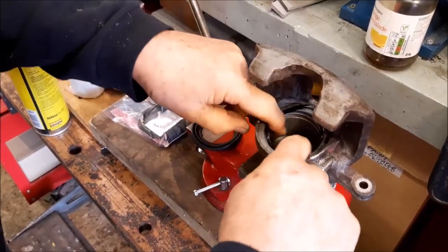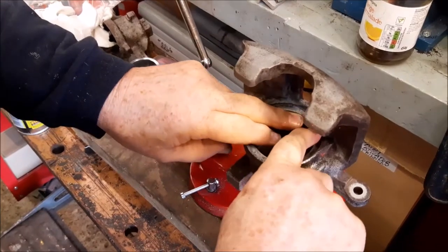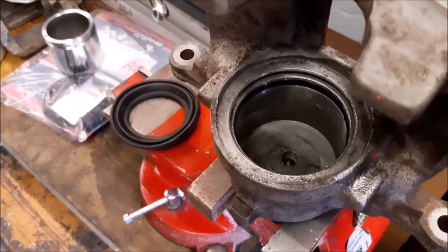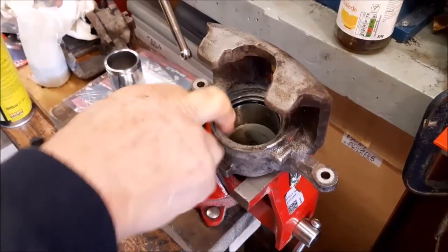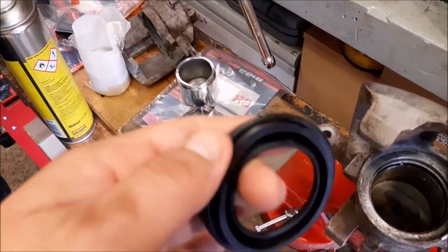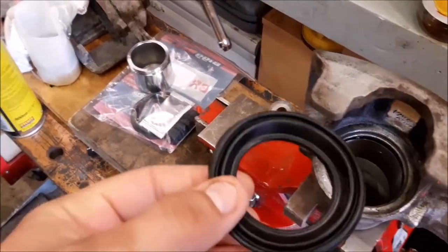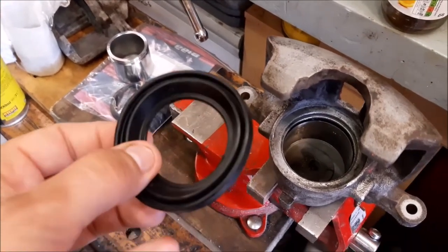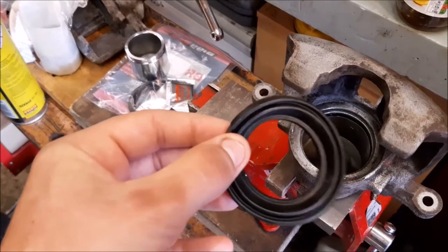We're putting the special silicone grease that comes with the kit into all the places needed. We've put the silicone grease onto the rubber seal and we're putting that in now. If you notice, there are two grooves running all the way around — the seal goes in the bottom groove, the one furthest away from the top. The second groove is for the dust seal to go in later. That goes in fairly easily, which it should do. Next is the dust cover. This little lip here is the bit that goes into that seal, so we're putting it into the caliper first, and then this little lip ends up in the relevant lip on the piston. When pushing the piston in, it can either not go into the lip on the piston or it can remove the lip from the caliper, so we'll push it through carefully.